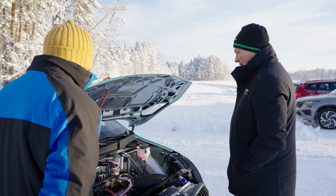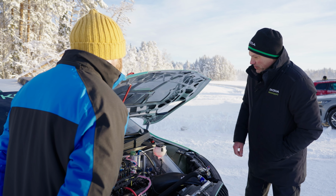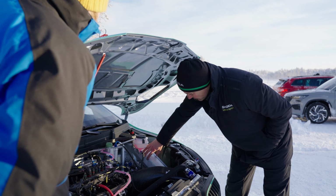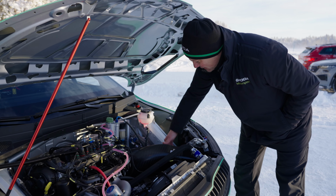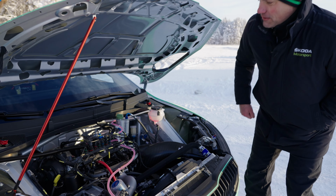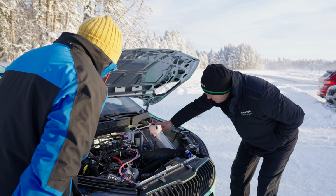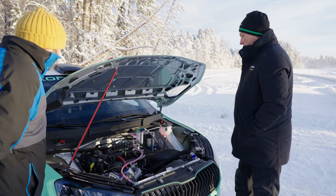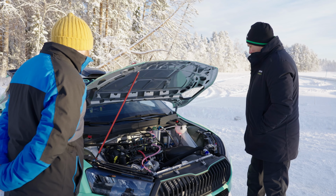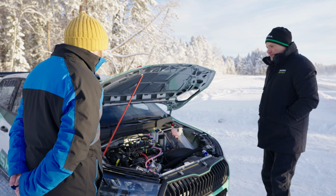And if we are talking about the engine bay, you can see that as well the body shell here is modified because we have this big reinforcement between the fixing of the suspension point and the chassis rail. There is as well here some piece of the roll cage which is reinforcing the body shell. But for example, the lights, this is the standard one.